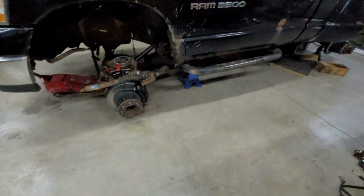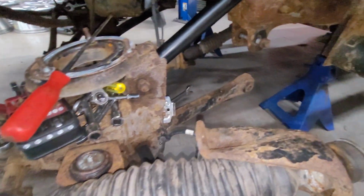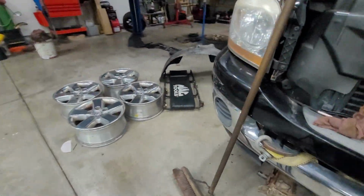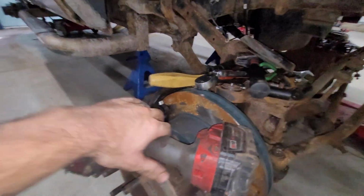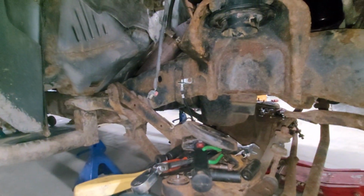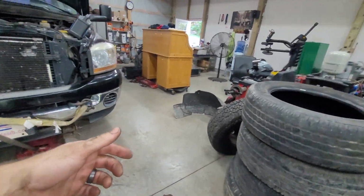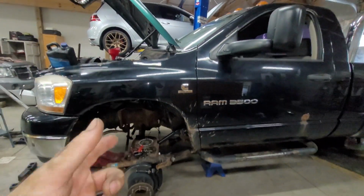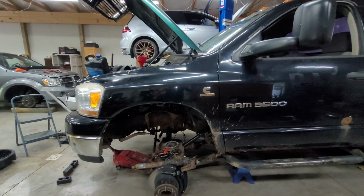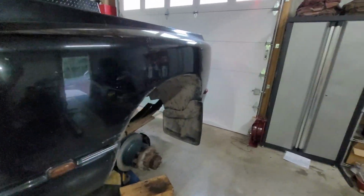Fun, fun. All right, as you guys can see, we got one of the control arms in, and my battery died. And that bottom one down there, we're not gonna get that unless we have a full charge. I got all the Zerk fittings in, mess cleaned up. And this side, like I said, we started working on that, but battery is dead. So, I'm gonna bring the charger and bring my truck back so we can start pulling the other springs. And then, once that comes, throw this thing back together. We'll check the rear, probably send it out for an alignment once everything's all said and done. So we're still waiting on the gallon of oil, and we're probably gonna drop the tank and check the lift pump, figure out what's going on with that.